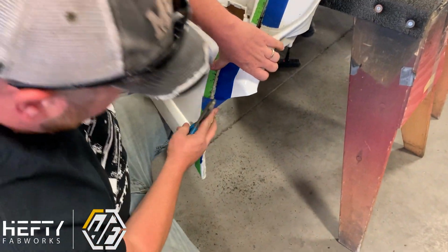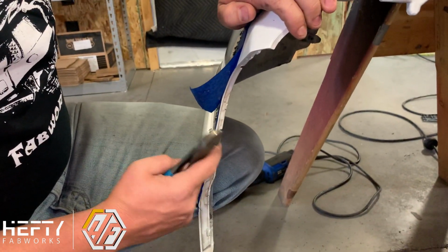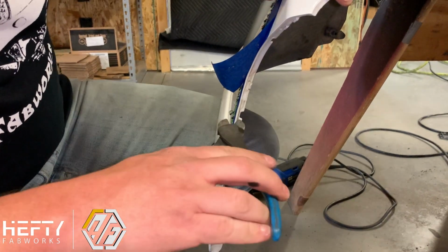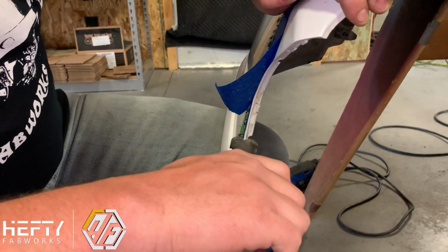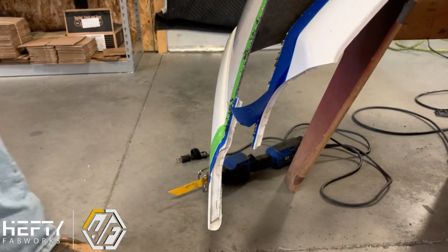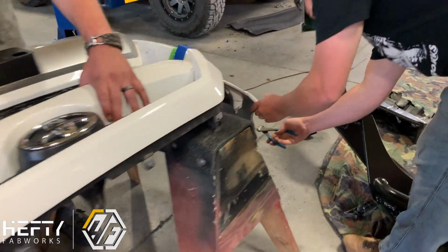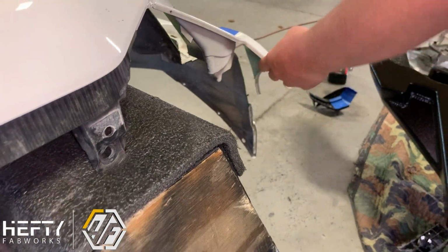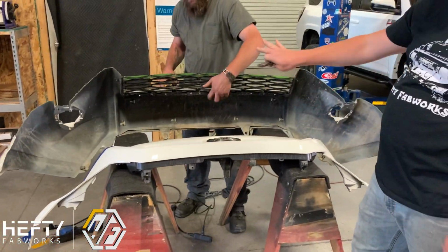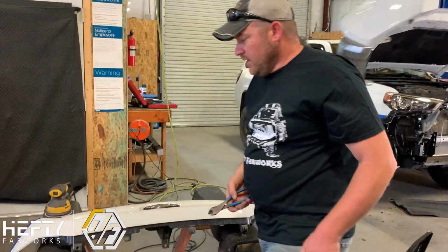We have the actual cut done. When you're looking at this inside lip right here, there's a little indent recess, and this corresponds with where we cut the black retainer. So all I'm doing is taking an end cutter here, and I'm going to cut it right like that, right inside that indent on both sides. So now at this point we can discard the lower portion. We're not going to need anything from that.